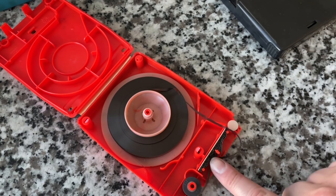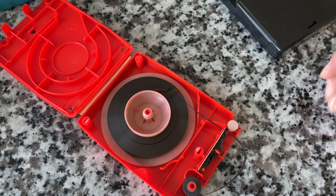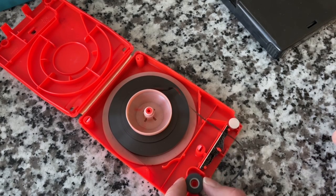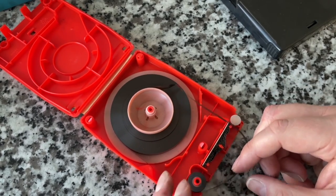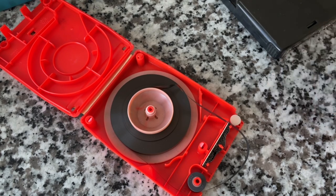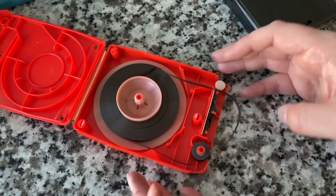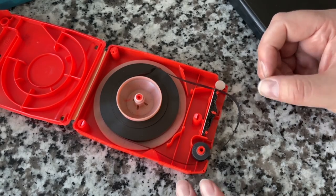Then the head obviously presses right there. This opening right here is where the switch is. Pinch roller right here, it's capstan drive. Cassettes of any kind, tapes, are interesting. This is a nice rubber pinch roller, because the cassette itself is part of the mechanism. In reality, the cassette is part of the mechanism to play. It's got part of the hardware. It's not just media. Where a compact disc is just the media, a tape is part of the equipment. And that goes for compact cassettes, and even more so with these cartridge type devices.